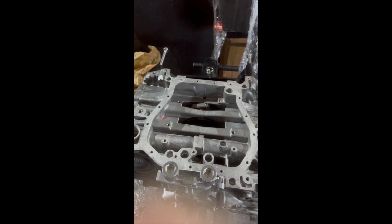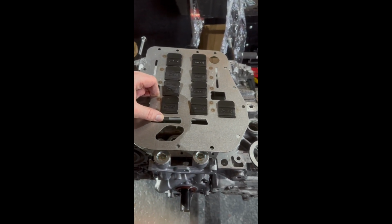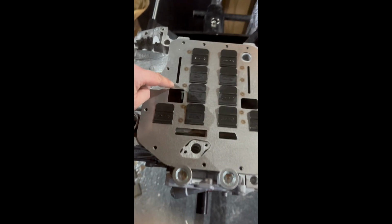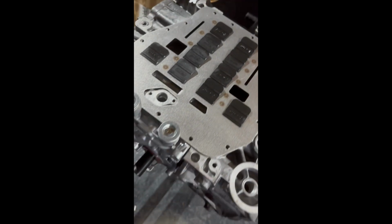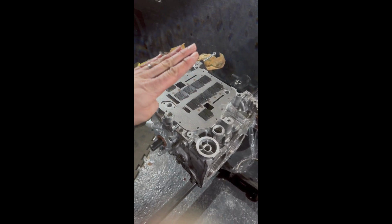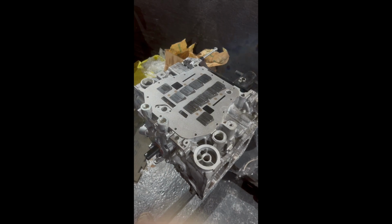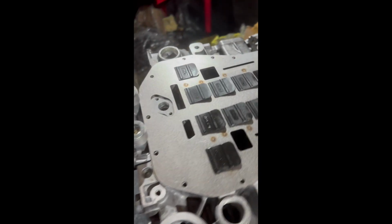Okay, from my last video, I went to put the Killer Bee sump suction on, and I realized I'd made a mistake, because I have this lovely Roger Clark Motorsport baffle plate. So this actually goes on first. We'll seal that down, then the sump suction, so it fits in like that, and that gives you clearance for the bolt holes for torquing down your baffle and your suction. So hopefully all good. We'll get that one tightened in, and that keeps your oil where it should be, drains down into the sump, because obviously this is upside down and it can't move when you're doing high cornering speeds and things like that. So we'll get that all lubed up, and that's how it looks.